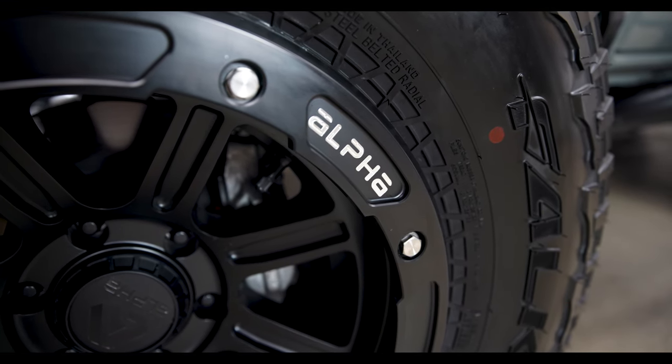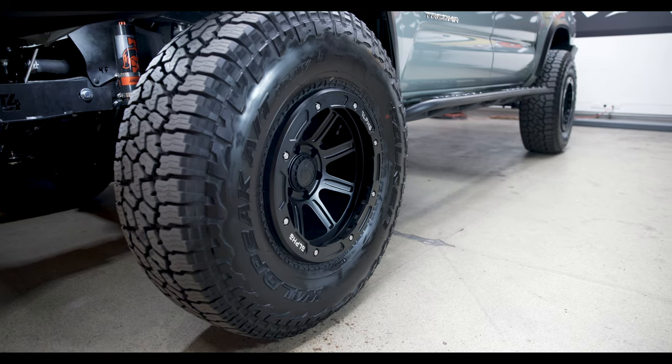The wheels and tires on this rig are some of my favorites — actually what I'm running too. These are the Alpha Equipment X Commanders, a hybrid wheel. You can run it as a normal wheel with just the base, as a true beadlock by moving the mounting point, or with street lock rings like these. Street lock rings offer a lot of protection — if you bash them on the trail you can replace them for around $60. They also have dual recessed valve stems, so you don't have to worry about damage on the trail.